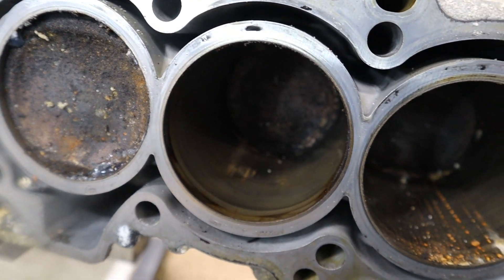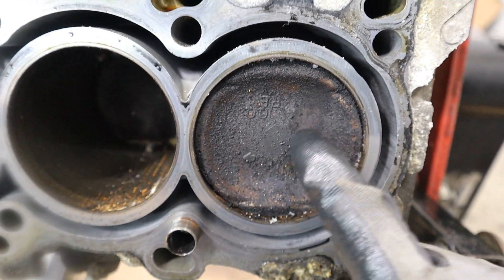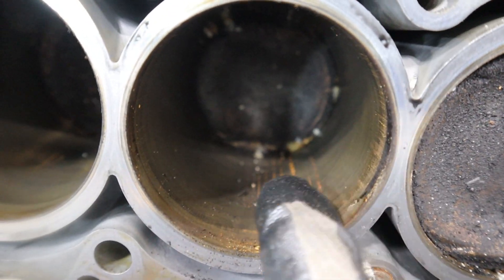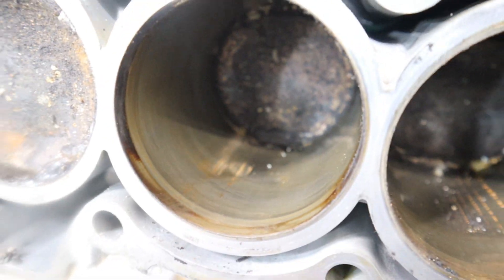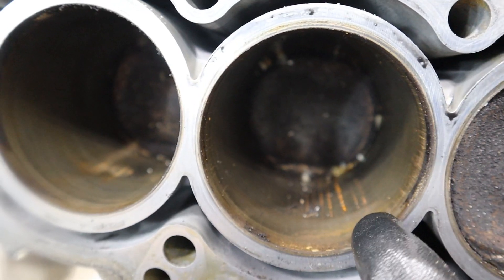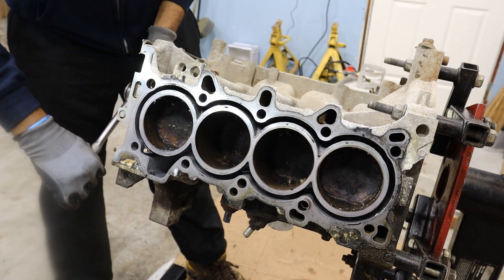The head gasket on this is a three layer steel and it looks fine — I don't see any breaches; this was a running engine. However, when you start to look at the condition inside, things are not looking all that great. We do have a bit of carbon build-up on the pistons as you'd expect. There are some vertical scratches that look like rust marks, and the cross hatching is not that great. You can see at the edges there are steel liners, and as you can see by the rust it's not just a coating like newer engines.